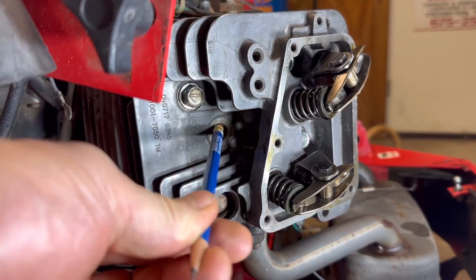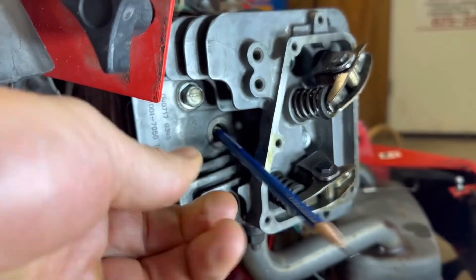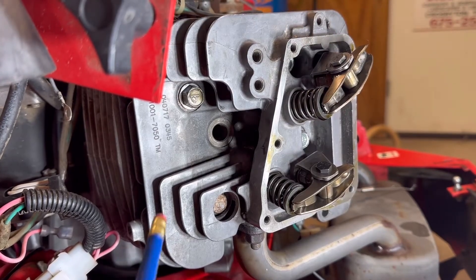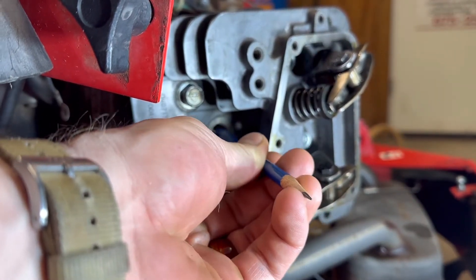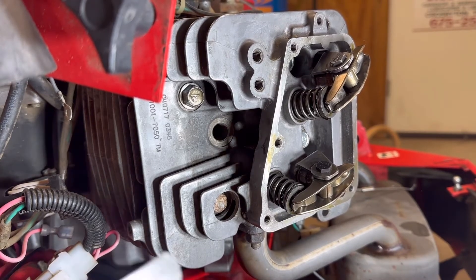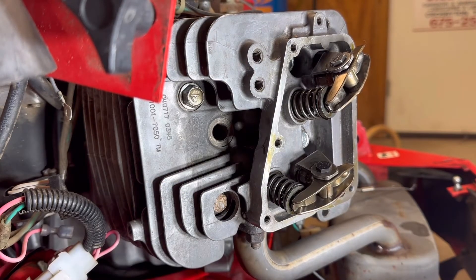Because if you're at the wrong top dead center — for example, if we go all the way through and come back up, you can see on the suction stroke we're pushing down valves at the other top dead center. So if you feel the piston at the top but you're pushing down valves, go ahead and do another full rotation all the way back down and up. At the very top right about there, you can see we are loose. So we've got it at top dead center, both valves are loose. The setting on this Kawasaki is between 0.004 and 0.006 inches on both the intake and exhaust.